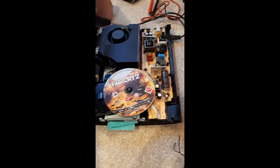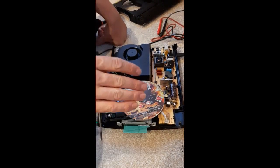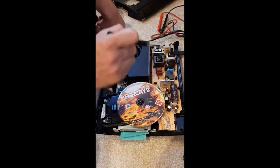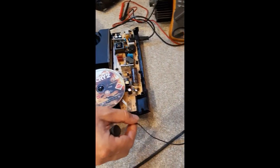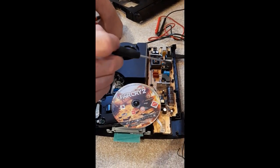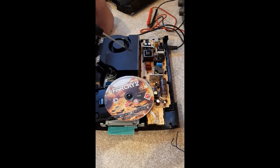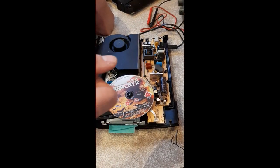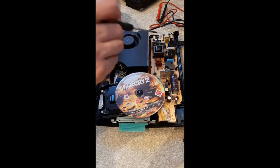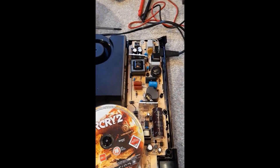If you have got a PlayStation where the red light comes on, then it goes green, and then turns off after five seconds, I'm pretty sure it's the five volt delivery. The way you can test it - obviously being careful as that's 240 volts - is to take a five volt supply, put it in there, turn the five volt supply on, then turn the PlayStation on. You should be able to run the PlayStation. If that works, it's because the five volt supply that keeps the safety check of the PlayStation is shutting down because the power supply is not seeing the correct load.